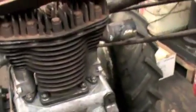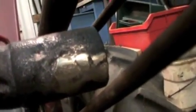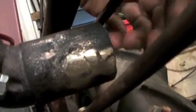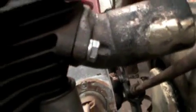Alright, well I just got the exhaust manifold on. You can see where I brazed it. I had a crack down the side right here, so I laid a lot of braze on there to make sure it wouldn't come undone. And it took real nice. I filed it down. I could make it look a lot nicer, but want to keep a lot of strength on that part. But brand new bolts in there, they got never seized in them. Same thing with those ones.